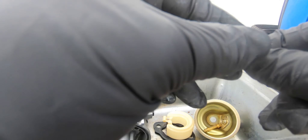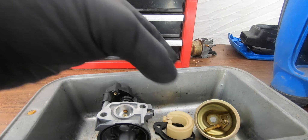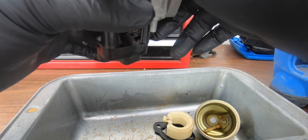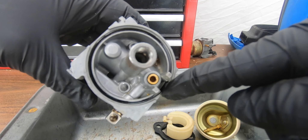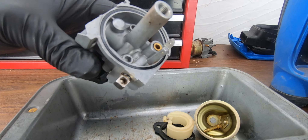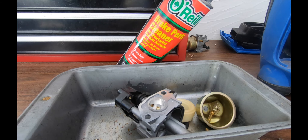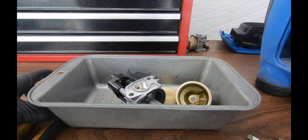And there you go. There's a little brass piece there — that's another jet. I'll show you how I test those. Usually I would remove this gasket right here, but this guy is not that dirty. The reason you want to remove it is because brake cleaner destroys anything made out of rubber.